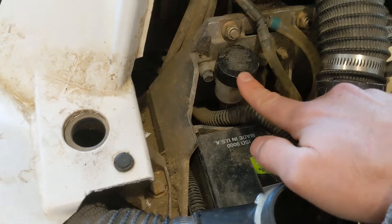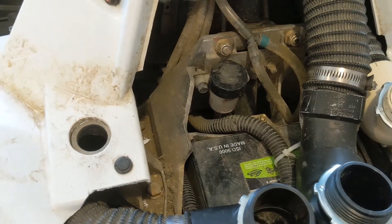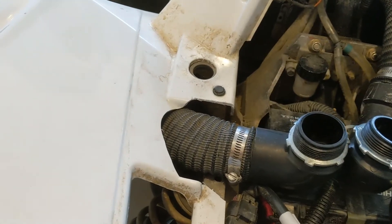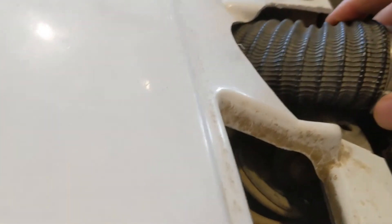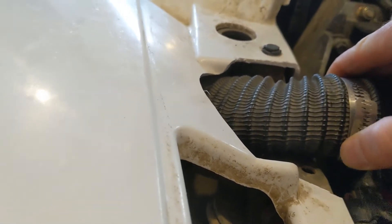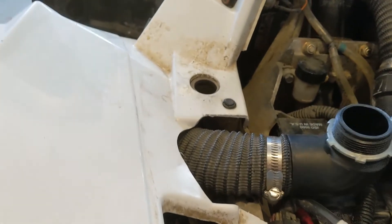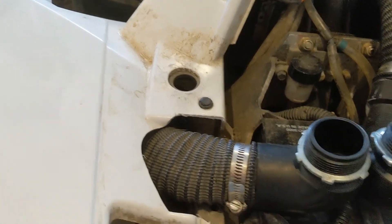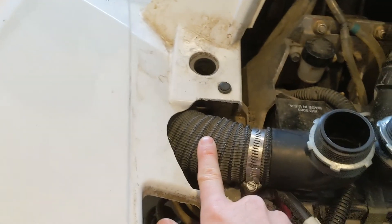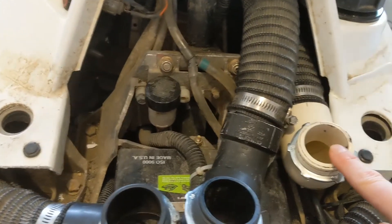Another thing is you'll find it'll be a very close fit once these all get together — it sits right up against this. By no means is this an easy kit to get to fit. It's a lot of finicking around. You can see I've slightly bent this hose as well to keep it lower over the frame, because otherwise your hood's not going to fit down properly. Maybe I've restricted the flow a little bit there — this is air intake for the engine. But we have two — here's the other air intake for the engine. So there's two, there's plenty of airflow there. These two here are for the intake and output of the CVT.